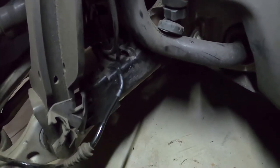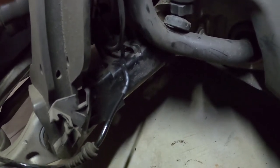Okay guys, so we've sealed that all up with glue lined heat shrink. Basically it's completely waterproof, the glue seals it all off. So there's no way anything's going to get in there, so that will be perfectly fine. We'll get back onto the computer and see whether it's happy now.